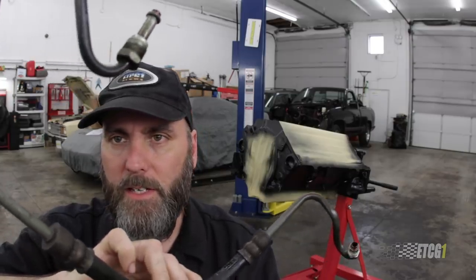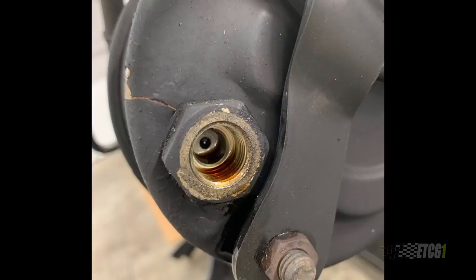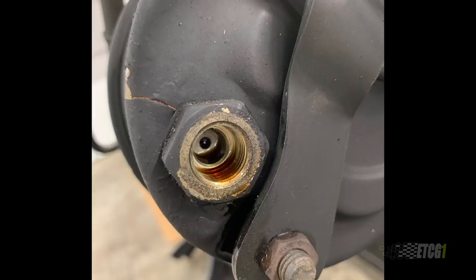I love overcoming the challenges. But this is about the power steering pump, which is a Saginaw pump that came on the truck originally. The new accessory drive kit also uses a Saginaw pump, but made all pretty and shiny. So I came in the next day, took the new power steering pump and my old high pressure power steering line, and tried screwing it into the back of the new pump — just to be sure — so that when I go to hook everything up, I'm not stuck unable to start the engine because the power steering pump has no fluid. And I found out: no, it did not fit. So I took pictures of the back of my old power steering pump and the back of my new one, and went on the hunt.